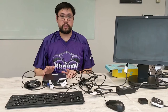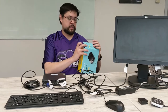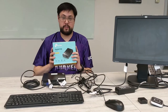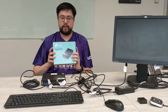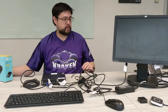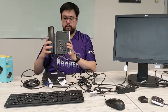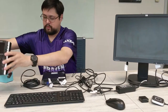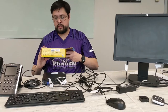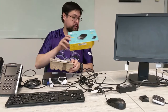For those of you who will be bringing your desk phones home, we have included with the kit a power over ethernet injector. This will get power to your phone and pass through the internet connection as well. It's a little bit complicated to set up, so let's go ahead and take a step by step on how to do this. Here we have your desk phone — we'll set that aside for now — and we will unbox the power over ethernet injector, or POE injector for short.